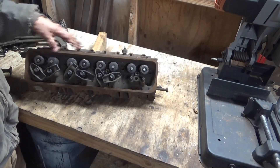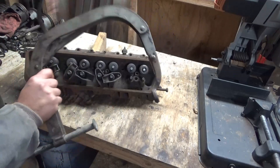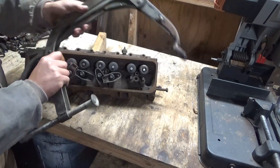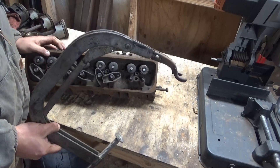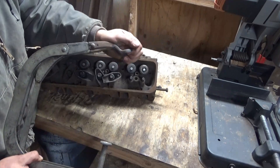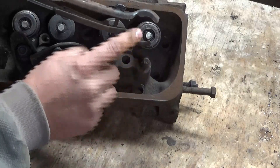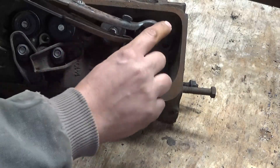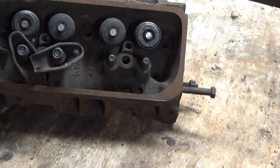Alright, so this is a small block Chevy head — it's a 305 head. This is a valve spring compressor; this is my favorite kind, it's the fastest. But on springs that are heavier than about 300 pounds or more, like big double springs, you might have a little bit of trouble with one of these. This part likes to start flexing and almost acts like it wants to break. So how this works: this sets up against the valve retainer and this part pushes up against the valve to compress the spring.